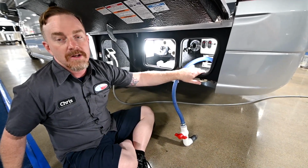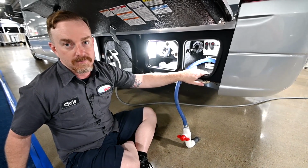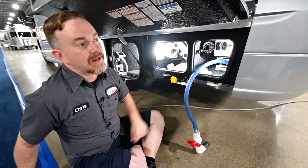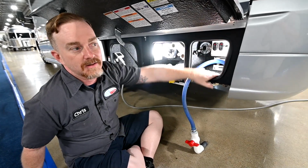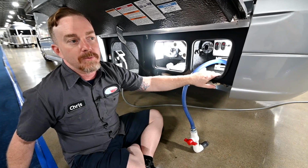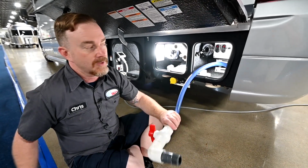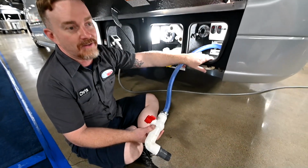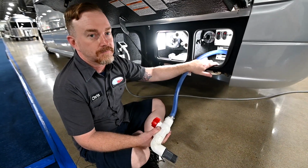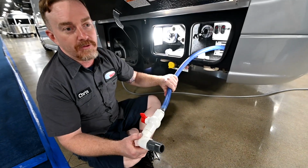After you have got this open, introduce water coming in and turn on the waste pump here. You'll see the waste coming through here and you want to run it until the pump changes pitch. When you hear the pump change pitch, turn it off. Allow the water to backfill. Give it another minute, 90 seconds, turn the pump back on. You'll continue to pump fresh water through here until that flow goes from pretty muddy to pretty clear.